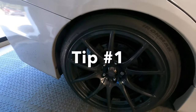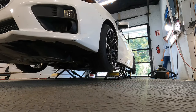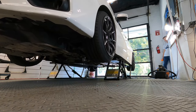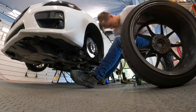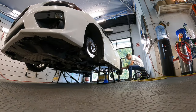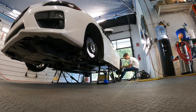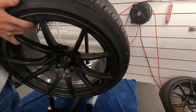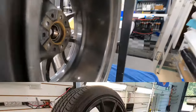This is the set of wheels that Brian picked up, so let's get started. Tip number one: if you can, elevate the vehicle — even if you're doing wheels-off or not — so you can spin the wheels and reach all surfaces easily. Two things to keep in mind for wheels-off work: first, safety when using a lift or jacks; second, liability if doing this for a customer or friend. Tip number two: grab yourself a good wheel stand, which lets you spin and keep the wheel stationary for a hands-free experience.